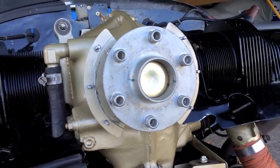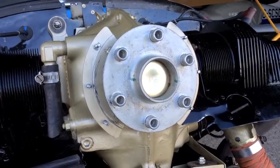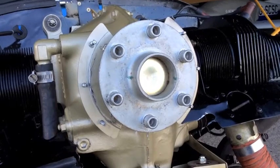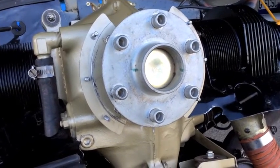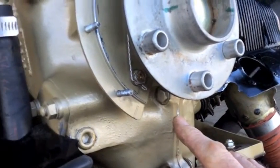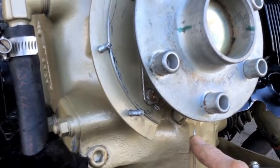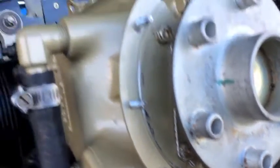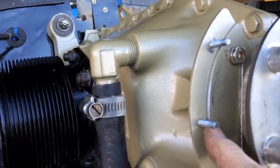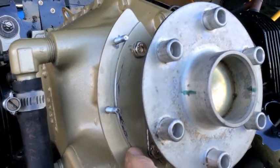The starter is a large flat disc and is easily distorted when being bolted down. This will cause problems with recoil of the starter and must be carefully attended to when fitting. In particular, fouling between the front of the crankcase and the assembly screws of the starter can occur here, and you can see I have had to file my crankcase a very small amount to remove a fouling point. I have also had to relieve the mounting plates themselves where a small radius was required on the corner here to prevent the starter from fouling and being distorted when bolted down.